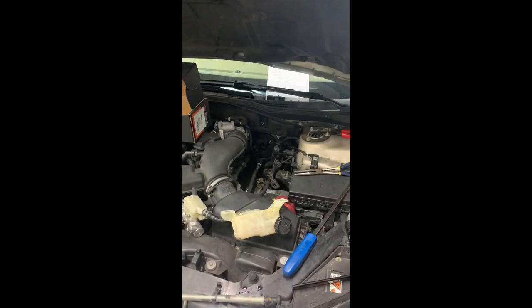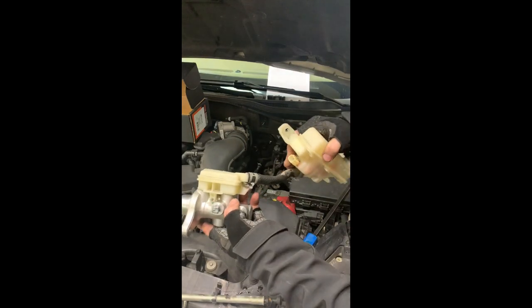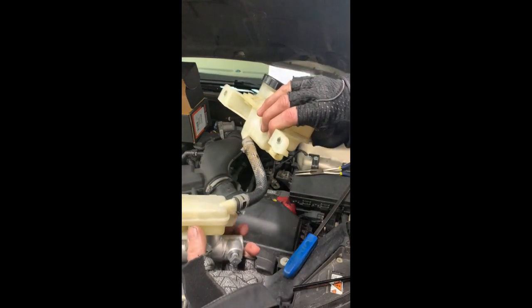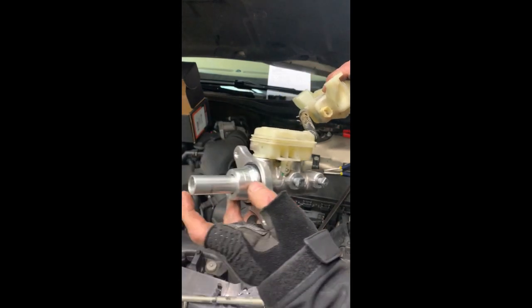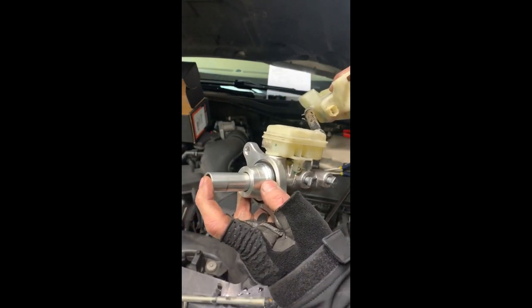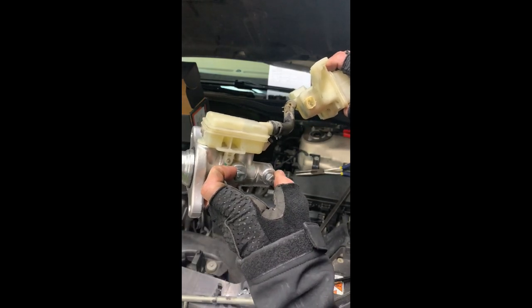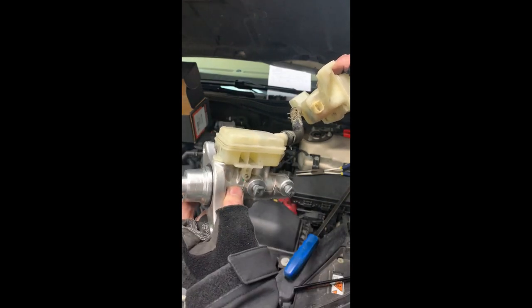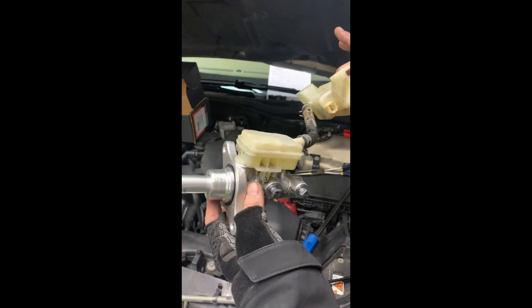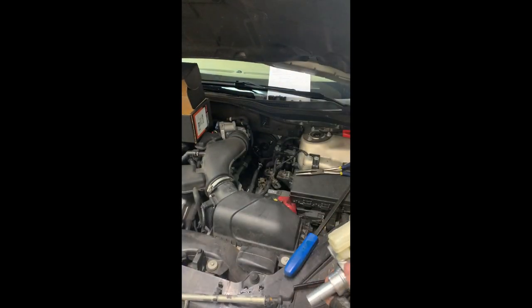2007 Lincoln MKZ — I'm back after a break. Leave the reservoir on, put your new master cylinder together, put the plugs in it, go to your bench, and move the piston with a blunt object in and out just about an inch. Open the bleeders to remove air — old school bench bleeding first — or you'll never get this thing to bleed. It'll only move about an eighth of an inch once all the air is out. There's your sensor to plug back in. Let's bolt this master cylinder back up.